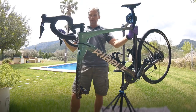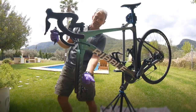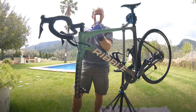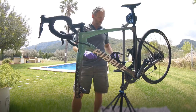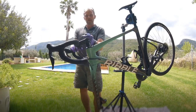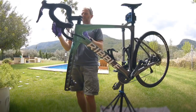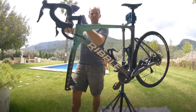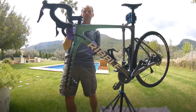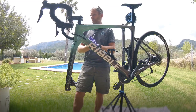Before we start, consider the position of your bike. On Shimano brakes, we bleed from the bottom and push the liquid up through the system into the reservoir at the top. There's no point having your bike at a downward angle — you want the reservoir to be the highest point and let gravity do the work. This allows bubbles to rise up through the system without getting trapped.